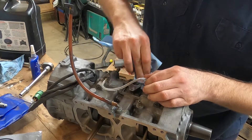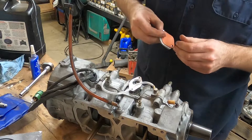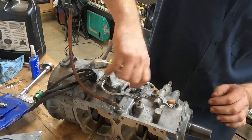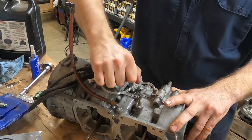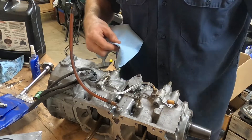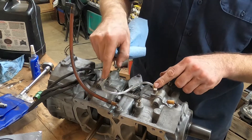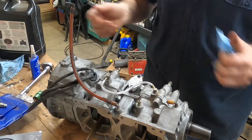I also got a bunch of oil all over that, so now that's nice and clean. Nice and dry — brake clean dries off really quick. I'll go ahead and put this block-off plate on and snug that down. Again, not really a great time to do it, but because I'm kind of out of other stuff to work on right at the moment, that's what's happening. Also with this block-off plate you're going to have to connect these two, so you'll use just a piece of small fuel-safe hose and connect those up.